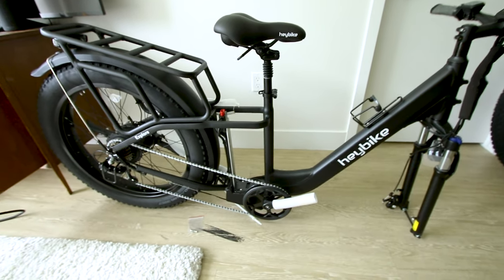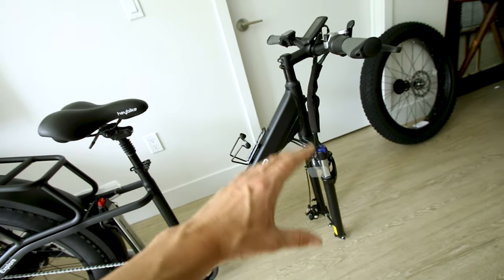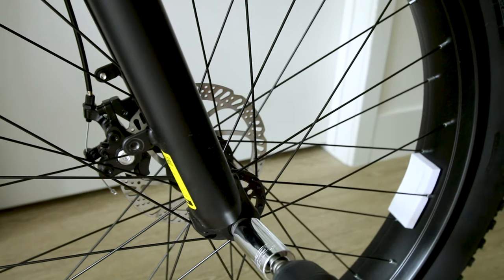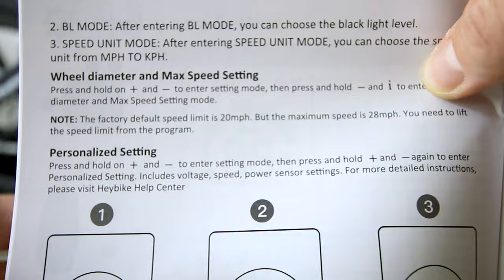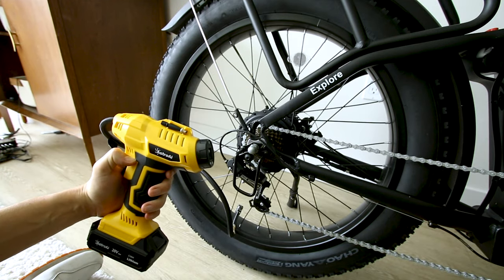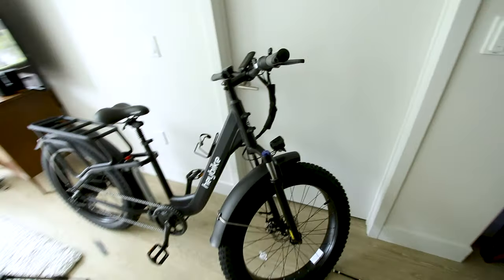When the battery is removed there's a big void behind between the wheel and the seat post. Typically the batteries are kind of up here, so it'll change the handling — less weight on the front, so maybe the front suspension might work a little better. There's also a lever specifically so you can get the battery on and off. There's no fancy app on this one but it shows you how to change all your settings in the manual. Default speed is 20 but we can crank it up to 28. It says to inflate your tires to 20 psi — they're on 11 now, so we'll set it to 15 because there's no rear suspension; we'll run these a little bit lower to give us more cushion at the expense of range.